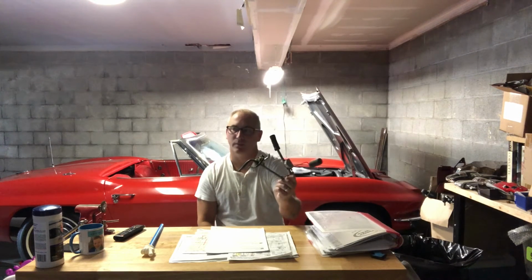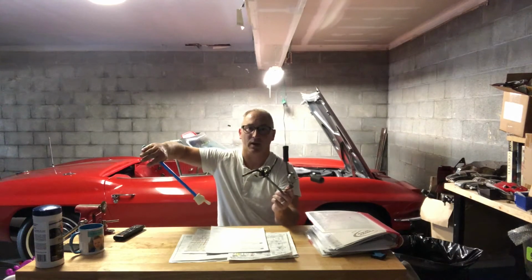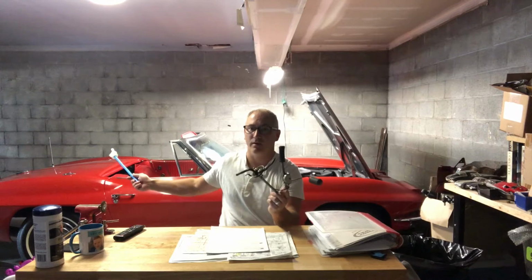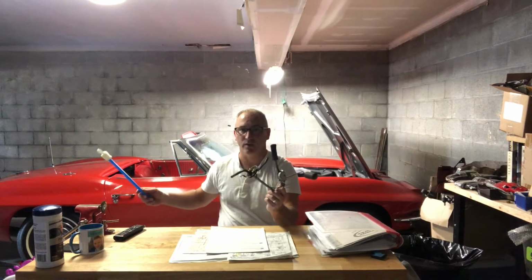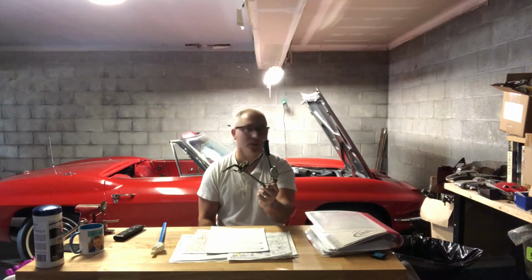But when I saw this, I thought, man, wouldn't it be interesting if this was the problem? Now, to get to this, you have fuel coming in through here, so I had to drain the fuel tank. Not only that, but I had to make sure I jacked up the rear of the car high enough that the rest of the fuel that I couldn't drain out was going this way, not towards the hole for the sending unit. And then I finally had to get the specialty tool to take it apart. You need that tool. Trust me, don't use screwdrivers, don't use any kind of wrenching. There's a perfectly made tool to take this out. I'll find that tool when we go specifically through this in another portion of this video.